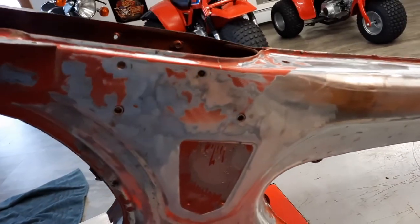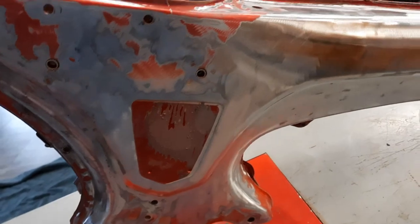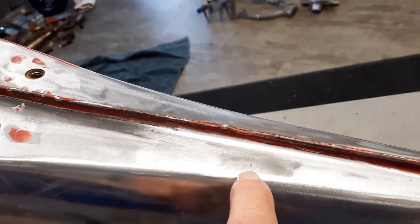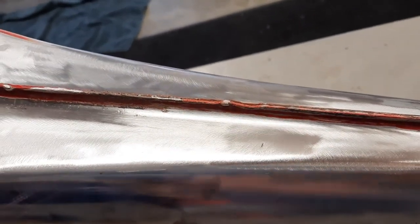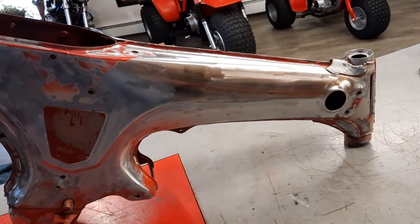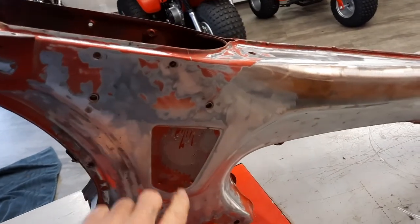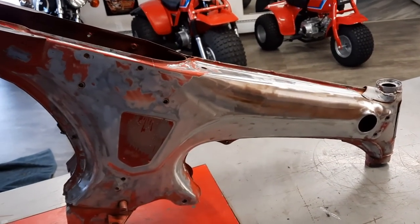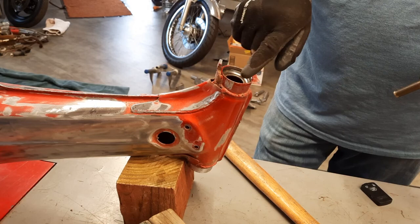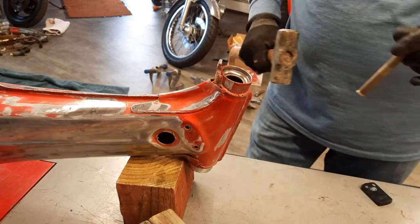I went ahead and spotted every little spot of rust that the wheel would get, just to save some time - I don't want it to bubble back up. The miracle primer will probably take care of everything else. There's no dents in this thing. We'll get this glue off and I think I'm just going to go right to primer with it. The bottom race in this is good; the top race would have worked but it was kind of questionable.